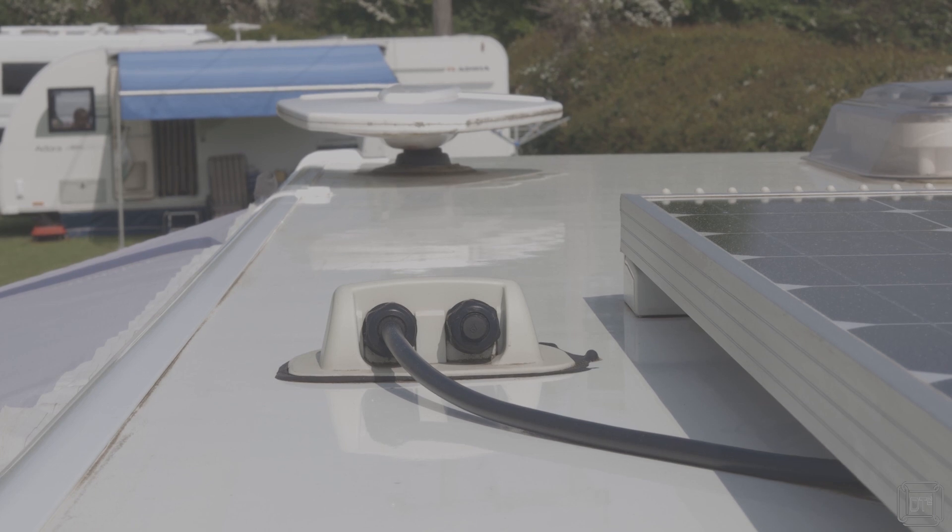For obvious reasons I didn't want to drill holes in the roof of the van, but because I already have a factory-fitted panel there is an existing cable running through the roof. This was another reason to run the new solar panels in series, since that ensured the existing cable was well within tolerance for the additional panel — only the voltage would be increasing. The existing cable is not that long, and since required cable size is determined by both current and cable length, it was within spec for either configuration, but I went for the safest option.